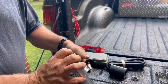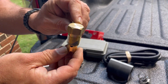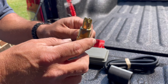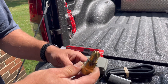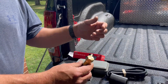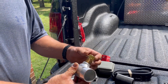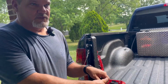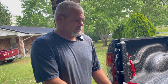If you're going down the road and accidentally flip upside down, that ball comes down and keeps fuel from coming out of the tank and feeding into the truck's tank and overfilling. That is one of the things that makes gravity-feed tanks legal — they're vented and they have this rollover valve at the top. If you've got a Chevrolet you don't need anything but a razor blade since it's a rubber hose — you cut it in two places and stick this in between.